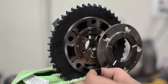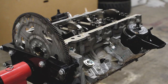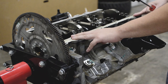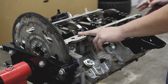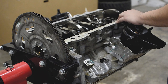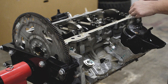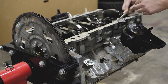We're going to jump right into this video starting by cleaning off the RTV on the surfaces. First I'll flip it around and start taking the RTV off the oil pan mating surface. GM doesn't use gaskets — they use RTV on the oil pan and timing cover. You can use a gasket scraper or a razor blade, just be really careful. It comes off pretty easily — just be sure not to drop any into the motor.